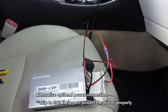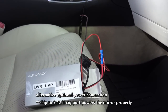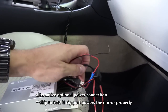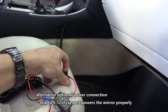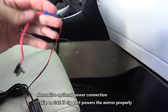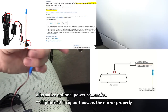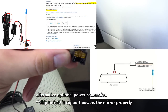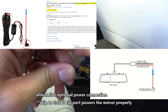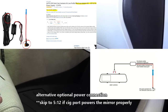Now, if you don't have a working cigarette lighter port, or your cigarette lighter port always stays on even when the car is turned off and you don't want to drain your battery, you're going to have to buy this accessory sold separately. This is a power cable that plugs into your fuse box. It's already assembled — you have your positive red wire and it goes to your fuse box just like that, with a five amp fuse already installed. It plugs into your accessory port in your fuse box under your dashboard — it could be on the passenger side or driver side.